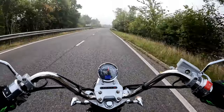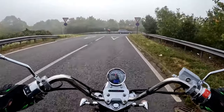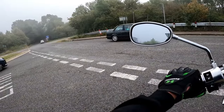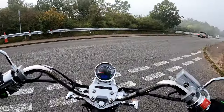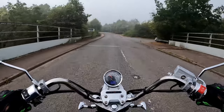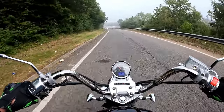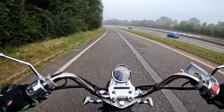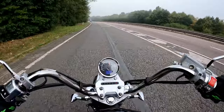Alright we're going to go over the top, down the other side, and back to the garage for the obligatory cup of coffee. We're going to use the rear brake this time — combined braking. What that means is the front brake will give you the front disc only, the rear brake will give you about 70% rear and 30% front at the same time. So we always say: up on the handlebars for a dry day, down on the foot for a wet day. You may notice I tend to trail brake in corners — just scrub a little bit of speed off, but as long as you don't grab too much of a handful you're alright. Keep it to dry days only; don't go grabbing front brake on a wet day or stay off the brakes in corners.